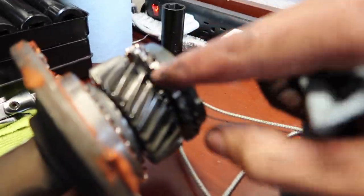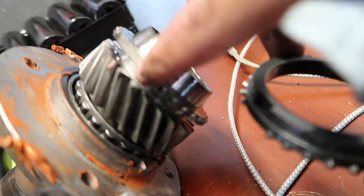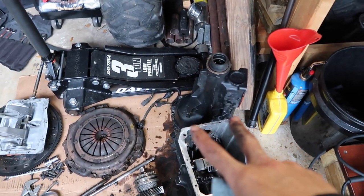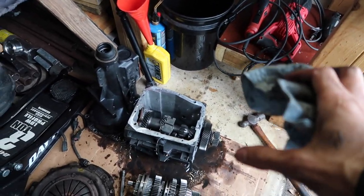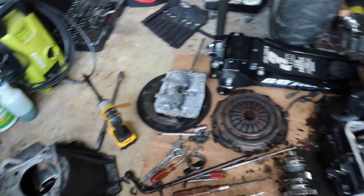Now that we have her all blown apart and we see exactly what we damaged — also on this input shaft I noticed what I believe might be a missing chunk, or maybe that's supposed to be like that because it's a pretty clean shear. I'm not 100% sure, I got to look into it. I think all this looks okay — it's just those two gears that are completely destroyed. I'm going to look into that, maybe try to find a T5 diagram so I can see exactly what everything is and then possibly order whatever I see is damaged and replace it, and maybe get the T5 back in the car just so we can drive while I save up for a TKX.